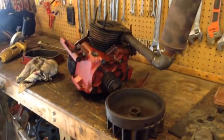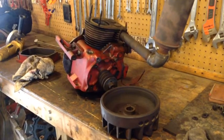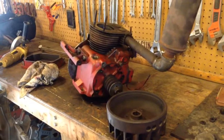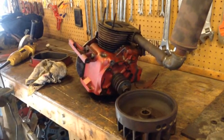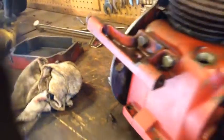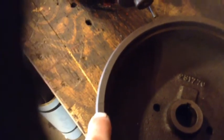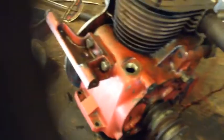One neat discovery I've made, which I've been trying to figure out, is the timing marks. After some research and cleaning this engine off — because it was caked with tons of stuff — I noticed this little access plate that pops out. When this is on, there's the marks: there's an S and a T. I think when it's at top dead center, the S is shown, from some of the videos I've seen. I got this all cleaned up and I'm just waiting on the parts.